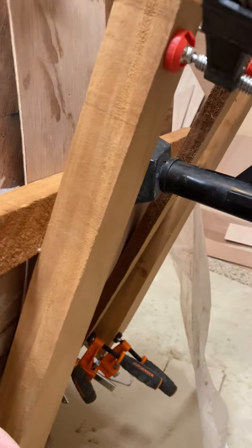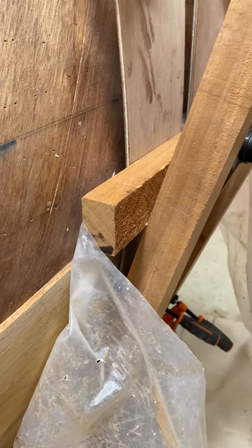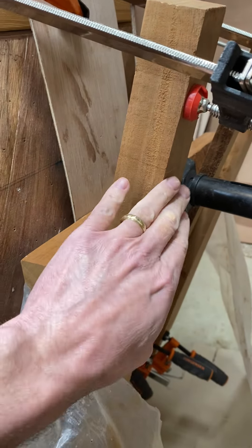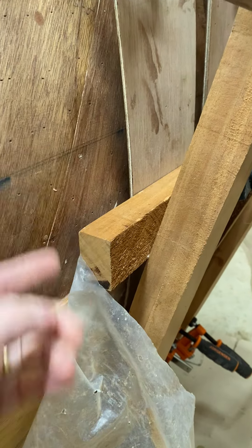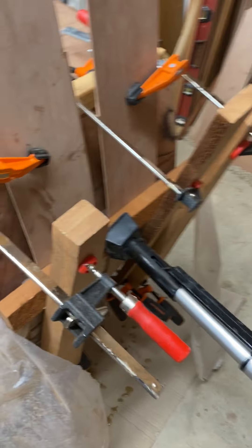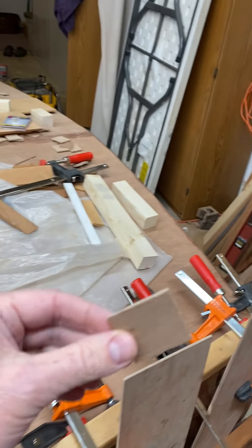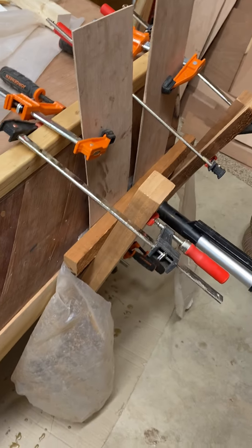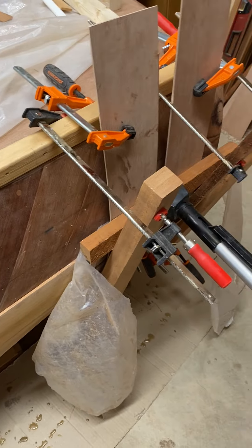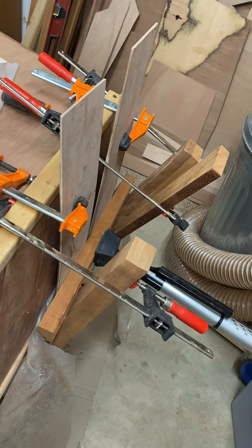The four millimeter pieces really help the bottom conform, and then these thicker ones — plus a board like this — really help push the top part of the board to conform to the hull better. I also use little washers made out of four millimeter ply. My composite air nailer is used in general when I don't need additional clamping like this.